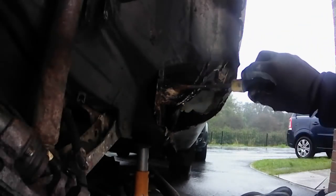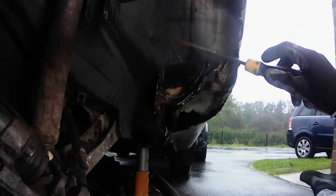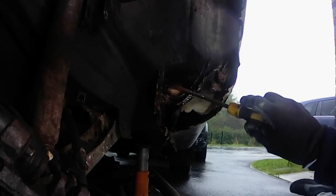Something I hadn't really thought of is that there's an underseal coat that's been applied to most of the sill. Something that hadn't occurred to me is I actually need to get this off, because I need to have a surface that I can weld to. The idea being, what I'm going to do is cut this piece out and weld a new piece in, and to do that I'm going to have to be able to weld to something,